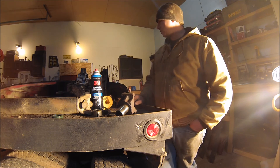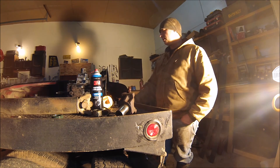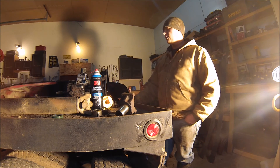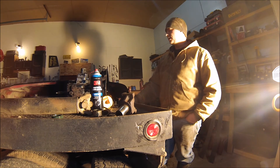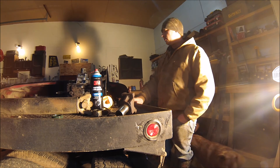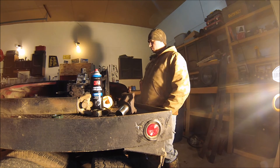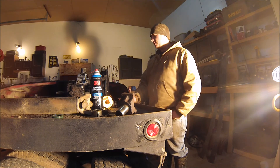I'm also going to replace the seal on the front because it's easy to get to and I think it was also leaking. Either that or at one point the rear main seal was leaking — I wouldn't be surprised if that was the case as well — but either way, the inside of the bell housing was very oily, let's put it that way.